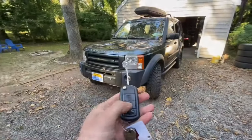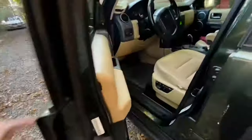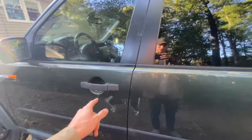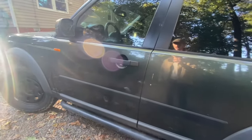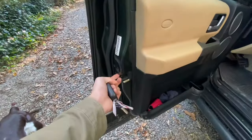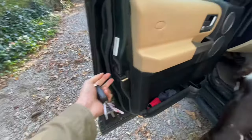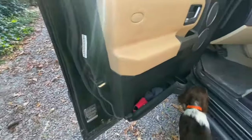So let me show you what I did. Unlock. Lock. Okay, pretty good. Not getting in there. Let's try the driver's door. Nope. So, there's my problem. The actuators, or at least the mechanism for the locking, does not work on the driver's and passenger side doors. What I've seen on YouTube is you have to take the door panel off, and there is a plastic L-shaped white actuator that is potentially broken or is overextending or underextending where it should be. And the fix, apparently, is you just bend one of the metal rods to not allow it to extend as much.